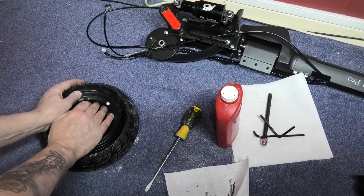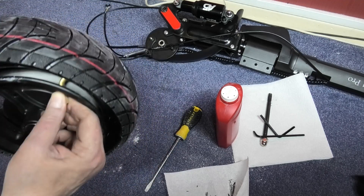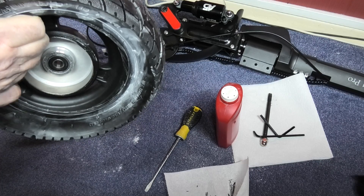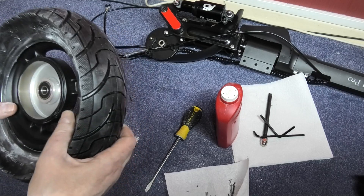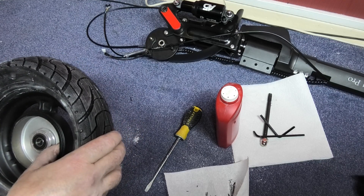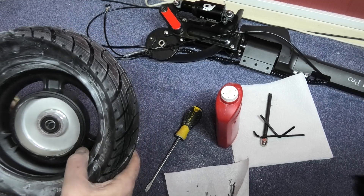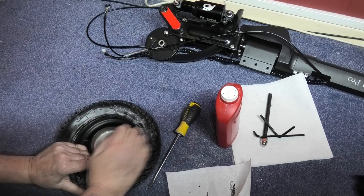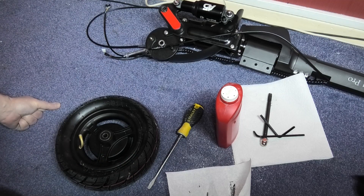Although these tyres seem to be a smaller diameter. So that goes in there perfectly, then pull that — make sure that's not pinched anywhere — and then go around the other side and make sure the tube is in the rim itself rather than sitting out in the tyre. Then you get the valve side. I always do the valve side first so that when I lever on this side it doesn't catch the valve. So put the valve side in first and then push down as much as you possibly can. It's very easy to change a tyre most of the time anyway.